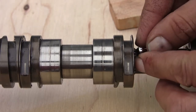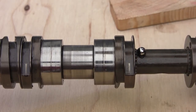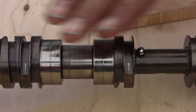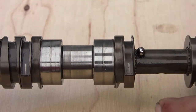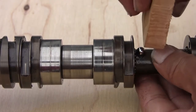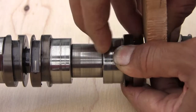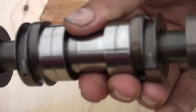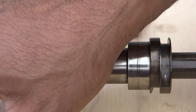Place the ball right here. The camera is leaning, but you want to have it even. Use a small piece of wood — do not miss the ball, it's going to fly like a bullet. Press on the ball and make sure you do not lose it. That's it — I just installed number three, so now I have three good lobes.